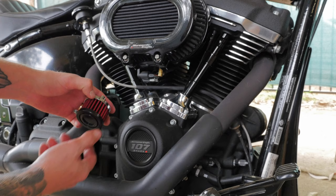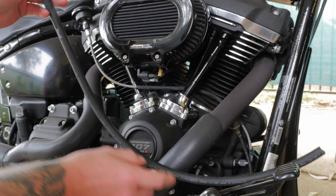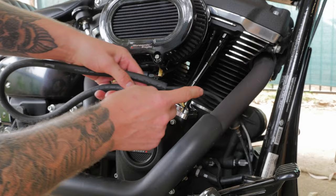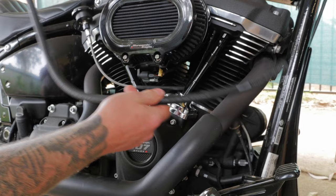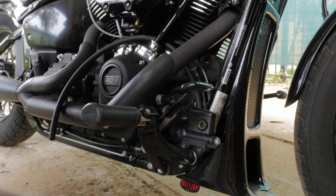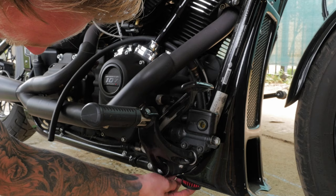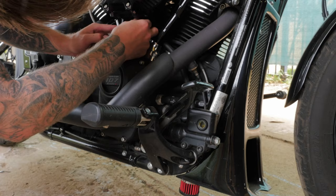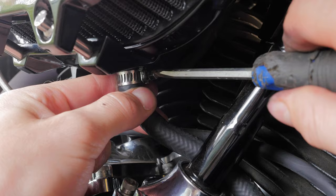I'm not going to have it on the bike for long — I'm not planning on waiting a hell of a long time for that bracket to arrive, maybe two weeks or so, but who knows with this whole COVID situation, it might take longer for shipping. So now I'm going to attach this three-eighths inch inner diameter hose onto that three-eighths T-connector fitting there, and then just connect the pod filter onto the end of this and run this line along my oil pressure line so I can zip tie it so it doesn't move and wobble about. I'm just going to attach this little hose clamp and cut the hose — it's always better to cut it a bit longer than what you need.